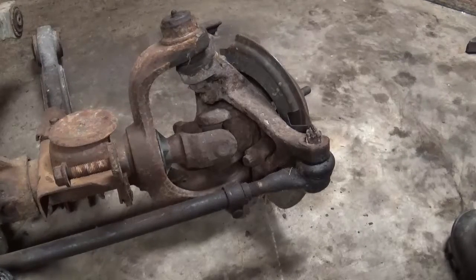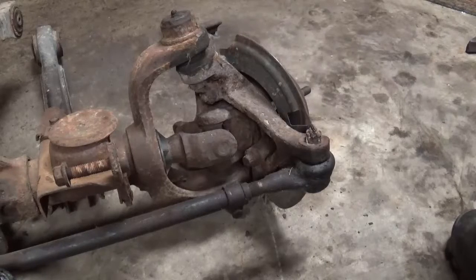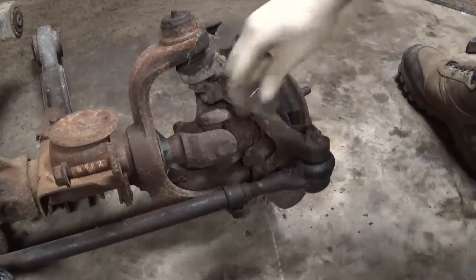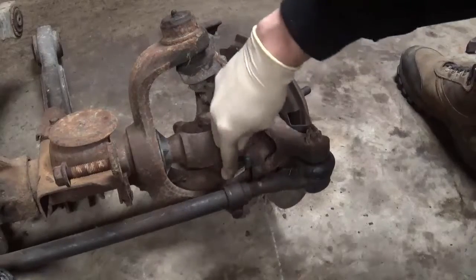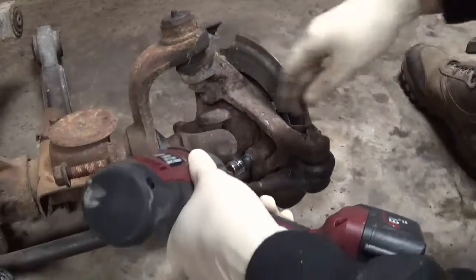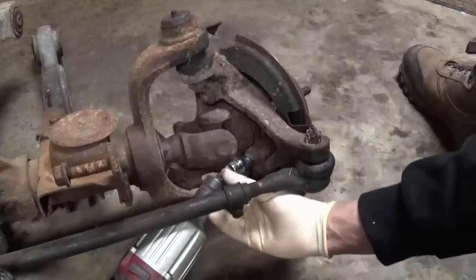To start off, I'm going to try and impact these bolts off first and see what happens. I'll go loosening and tightening, back and forth — you don't exactly want to break these bolts, which I've had happen before using impact tools. Another thing: one thing I don't like about Jeep is they use a 12-point head, so I have a 13mm with a 12-point socket, plus a wobble socket to reach it.